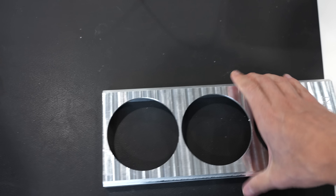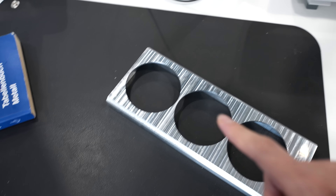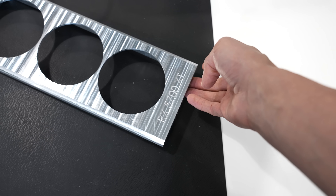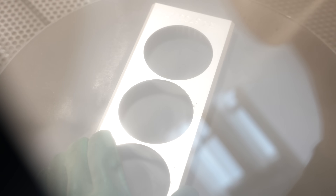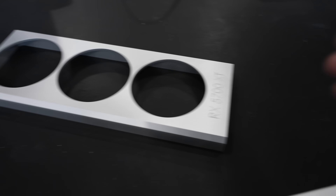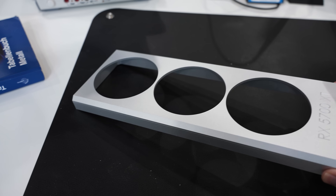Just missing the even surface — you can see there are lots of different surface finishes. But luckily since we have our sandblasting machine, we can give it a nice touch and should have the same surface finish everywhere. Such a lovely surface finish. It's just the same everywhere, it looks absolutely awesome. You could go further and do black anodizing or anything similar, but I think it still looks quite nice.